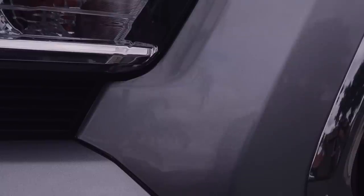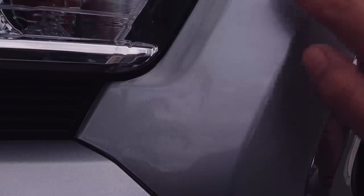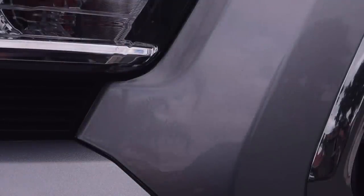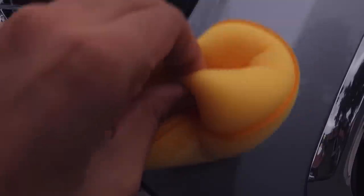In person I'm tilting my head around to check for any reflection and it looks much, much better than before. The exterior is still super glossy, same as before, and it looks fantastic. That's basically what the polish does. You don't want to overdo it because we are sanding away the clear coat — once you're done polishing, you don't need to do any more. The last thing I'm going to do to protect the outer layer is apply some Meguiar's paste wax with an applicator, just so there's a protective layer of wax wherever the scratch was.